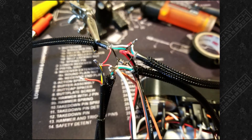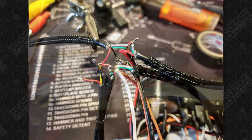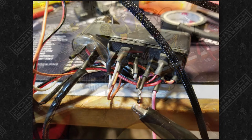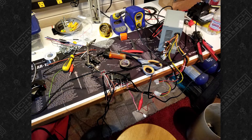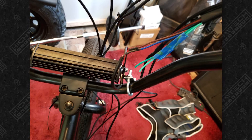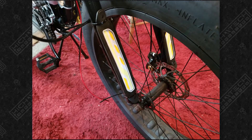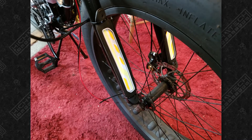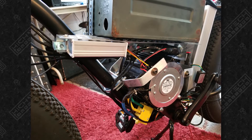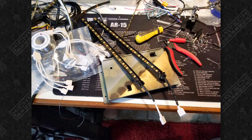A lot of wiring went into the lighting systems on this bike. I was going to buy a switchback relay from this company, but they wanted like 40 or 50 dollars, so I decided I could do it a lot cheaper on my own. Here I'm testing the system and then starting to integrate it into the handlebar controls. On the front forks I installed some daytime running lights which also doubled as turn signals — these LEDs were massively bright. And I found a nice little spot for the step-down converter to go from 72 volts to 12 volts, and of course more RGB strip lighting.